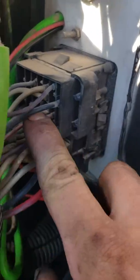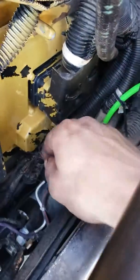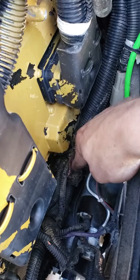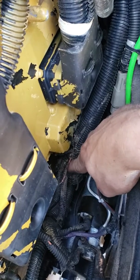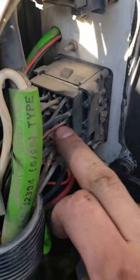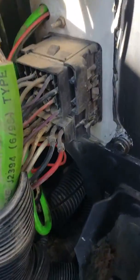And so from there I knew it was a red wire, and I started looking in my engine compartment and I found a couple of wires that were just chopped off. You can see them right here. And it's red. So basically I checked continuity between this point and this point, and there's good continuity.